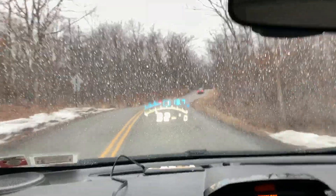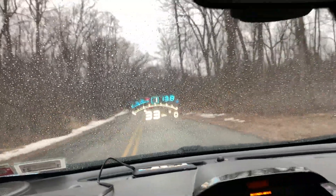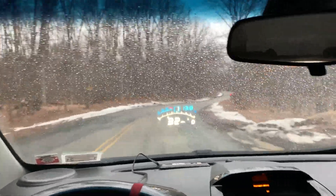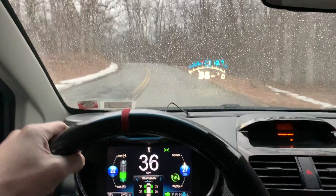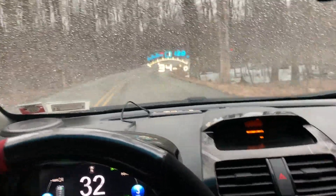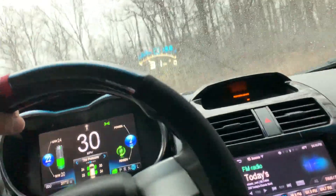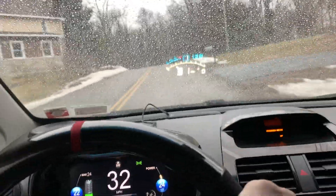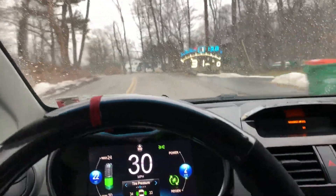Not a lot of it works, but you get the overall effect. It's like Blade Runner — the blue colors with the white. The RPM I can't get to work, but the speed looks spot on. It just takes a second for the gauge to catch up. I think it's reading the right speed, and we can dial in those correction factors to get it more accurate. But we are getting voltage — 13.8 volts from the 12-volt system — which is really cool.